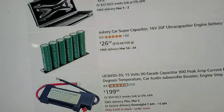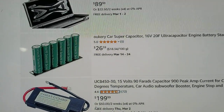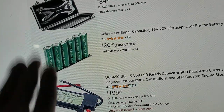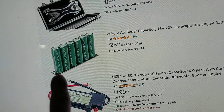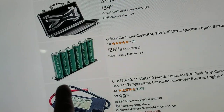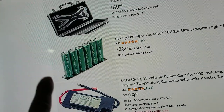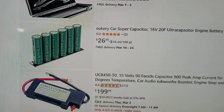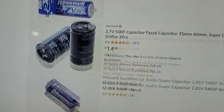You can test the capacitor with a multimeter. Charge it to full, let it sit for six to eight hours or overnight, then test it again. Your car battery goes up to 14.4 volts max. If it drops from 14 down to 13 or 12.5 volts after several hours, that's still acceptable — it's not draining too fast. You'll be driving the next day anyway.